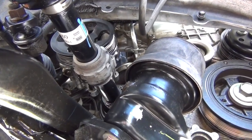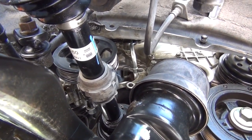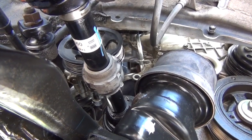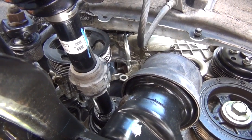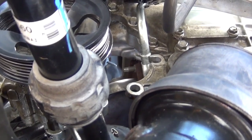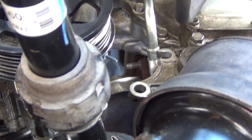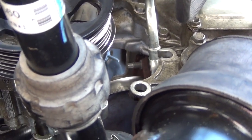Okay, so we're in the passenger side front wheel well, looking up the block. You can see where the tube comes down from the head. One reason I wanted to start on the bottom is you can see you're going to get hung up on this ear. That's where the power steering pump goes in. The short bolt goes in that bottom hole, and the top bolt goes all the way through the power steering arm, but it goes through that little ear. You can see where that's getting hung up on that banjo bolt tube. So that's why you want to come at this from the bottom to begin.